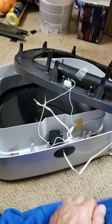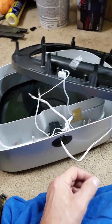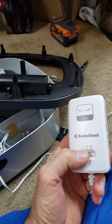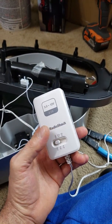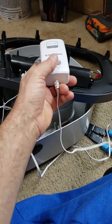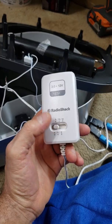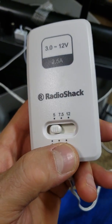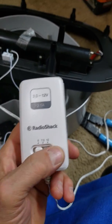I've already tested it and it works great. If you have one of these Nine Star trash cans and you're tired of going through batteries, I'd highly recommend getting a five volt transformer if you have three batteries. If you have four batteries, add another 1.5 volts — so four batteries would be six volts. Add up your batteries: three batteries is 4.5 volts so five volts is good enough; four D batteries should be six volts. In that case I would switch the transformer over to six volts.